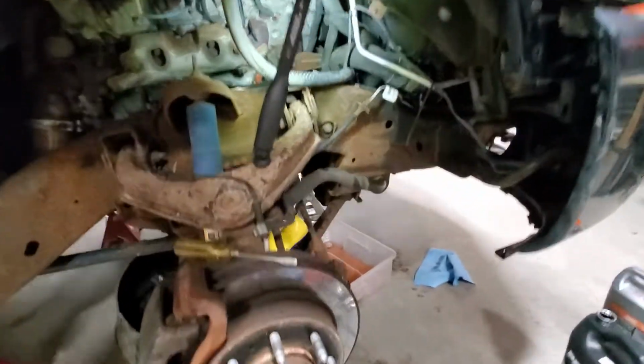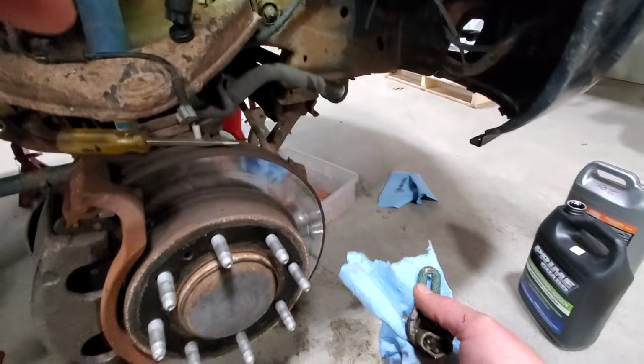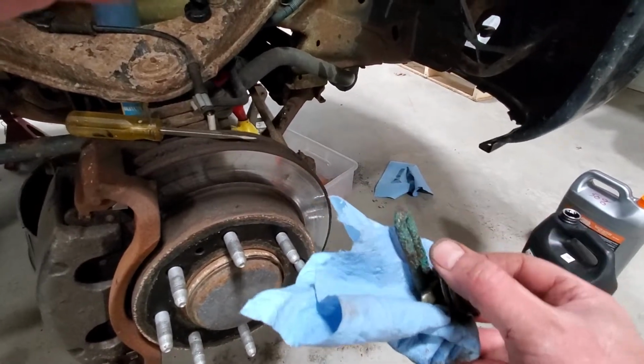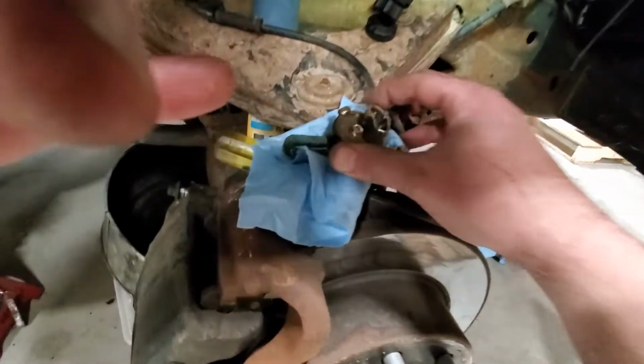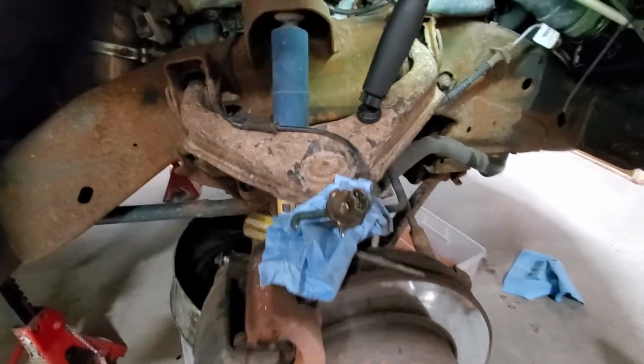And for people who don't live in a cold place, the block heater, you plug that in at night when it's 25 below, 30 below, and that keeps your coolant warm. And it sure makes for a nice, easy start, especially on a diesel, as well as heating the cab up real quick, because, boy, that's always a problem.